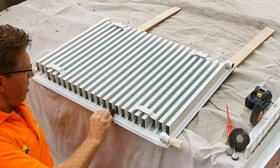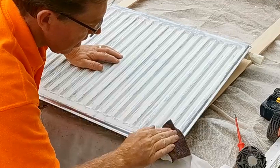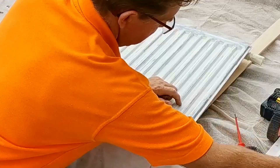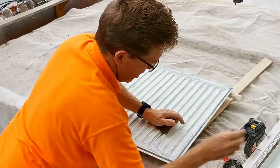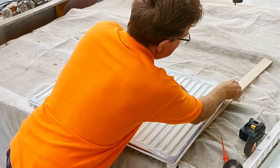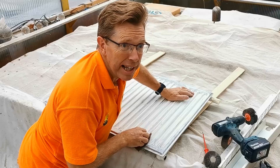Make sure you've got rid of all those burrs and sharp edges, because the flapper wheels do leave little sharp edges on the metal. Just go over it with a nice smooth pad and clean it all up. Also go along the bottom edge — any little rust spots that have been sanded down, just rub those down again. Preparation is what makes it good. If you don't do a good job now then the end job is not going to look good — as any painter or decorator will tell you.